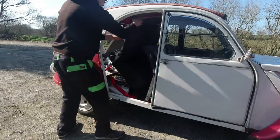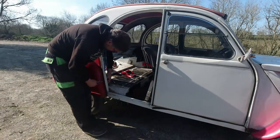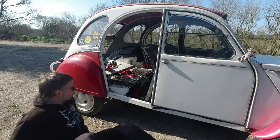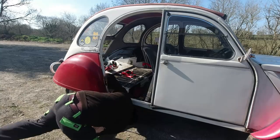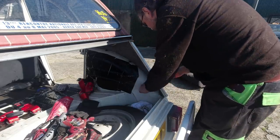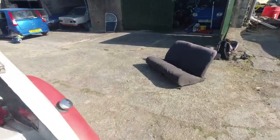We tip the seat and lift it out. It's sometimes scary how quickly these cars start degrading again. This one's really rusty down there because it sits in all the road grime, so I think we need some penetrating oil. We've now got three 10mm headed speed screws holding the wing in, but I've just realised I need to get the filler neck off the fuel tank, so I'm only going to remove one of the bolts for now.